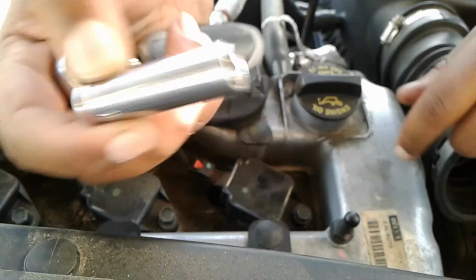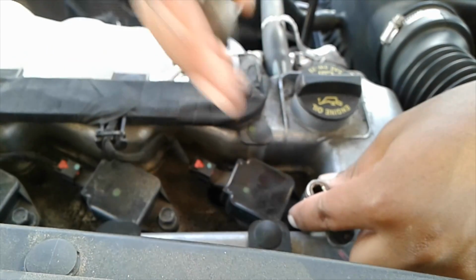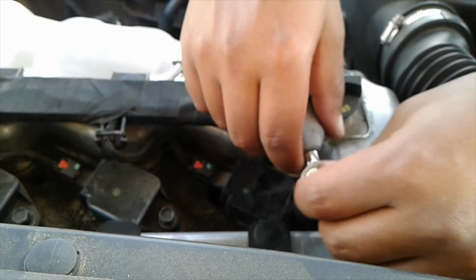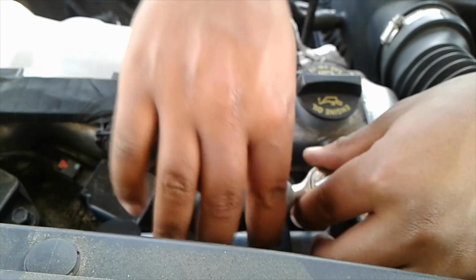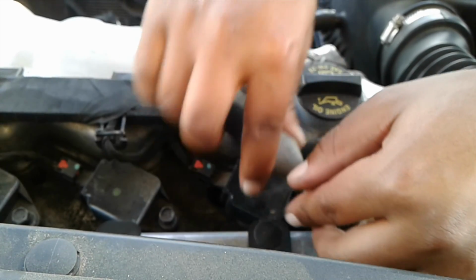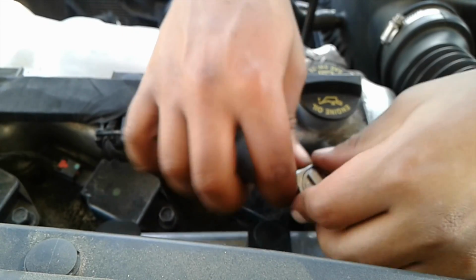So you can hand tighten this screw first, or, well, no, actually you can't. Take that back. So let's tighten this back in so we know we're done with the cylinder. And once again, this is a deep socket, 10mm. A deep 10mm socket. It's easier. If you didn't have it, you would have to do it like this, and it'll be hard to turn the socket.